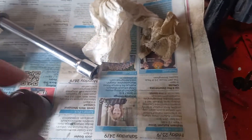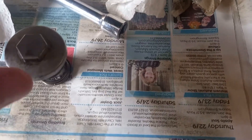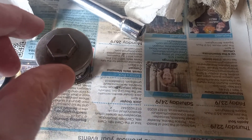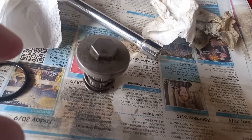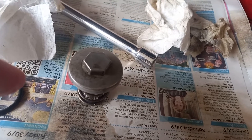So the correct order is that, and then the spring goes that way around with the coiled narrow end locating in the top of the cover here. I put a new o-ring in the cover — why wouldn't you — and the whole thing then torques up to 20 Newton meters. That's on my 2019 model; you might need to check if you've got an older version exactly what the torque value is.